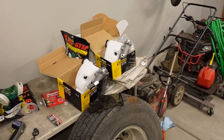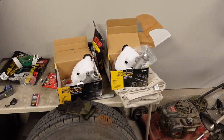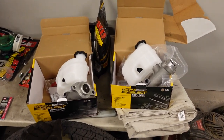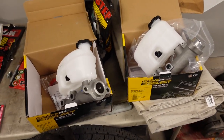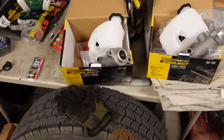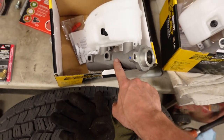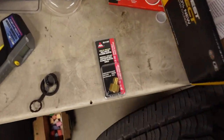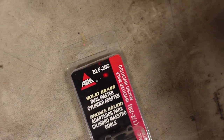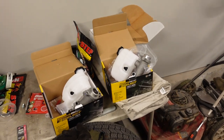Now let's talk about the master cylinder. You're going to have a different master cylinder between trucks that had four-wheel disc brakes versus discs in the front and drums in the back. One of the most popular workarounds on a GMT 400 truck is grabbing a GMT 800 master cylinder, bolting it on, and going down the road. I grabbed two of them — one from a 2500 HD with hydro boost and one from a half-ton with vacuum boost brakes. They both have the same bolt pattern, the same bore on the outside that slides into the booster, and the same half-inch fittings. The reservoir is slightly different; you'll need an adapter fitting — BLF-26C in solid brass, grabbed from AutoZone.